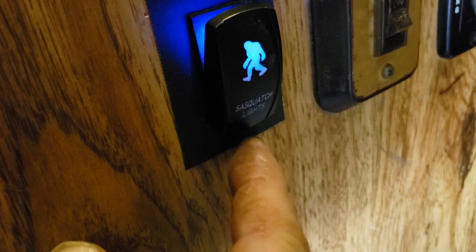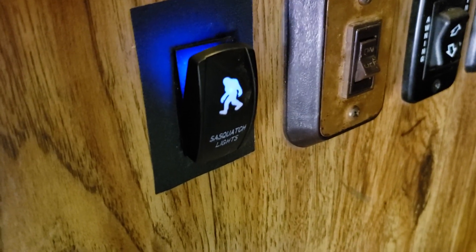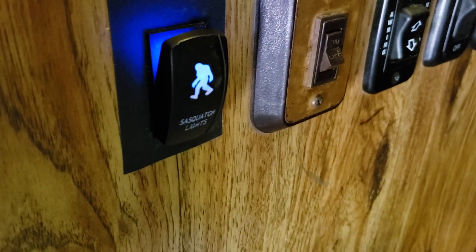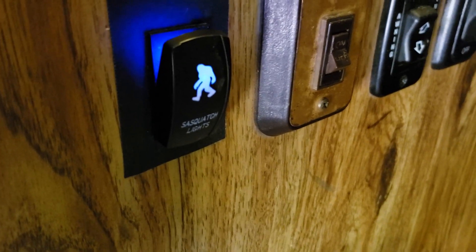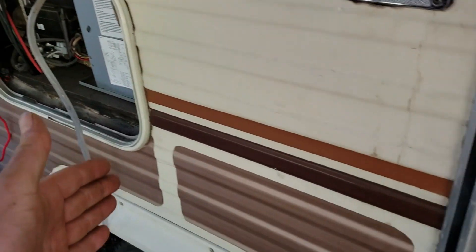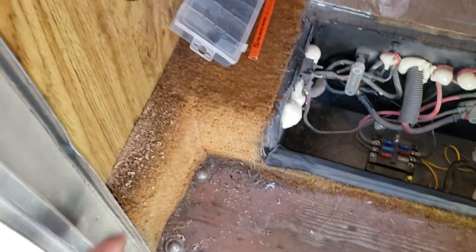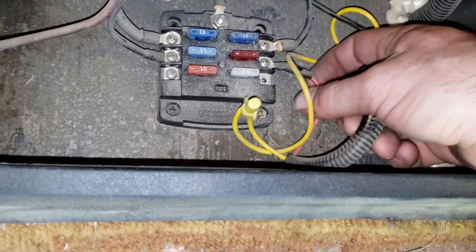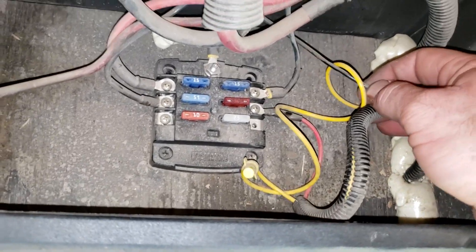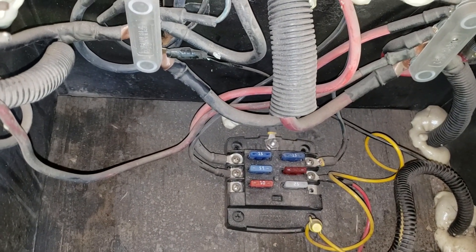The light on the switch is lit up all the time the way it's wired. If it were placed up front, you could easily wire it to turn on with your parking lights or instrument panel and off when the headlights go off. Mine is always on — I like to be able to see it at night when I'm stumbling around if I hear a noise outside, and it doesn't draw a lot of power. The wiring comes down from the refrigerator, goes to the switch and relay, and the positive is hooked up to a fuse box with the negative run to my negative bus terminal.